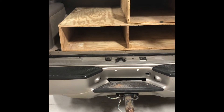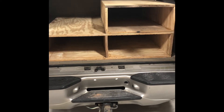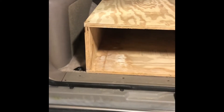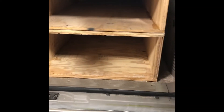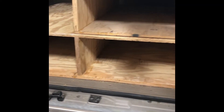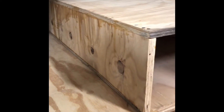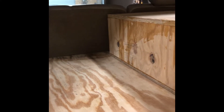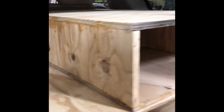I'm not going to get into how to build drawers — this isn't a carpentry video — but basically we used some three-quarter inch plywood we already had and will make three drawers next. All this is glued and screwed together. These are 46 inches deep. The second one up here is independent, not bolted down yet — I think that one was 41. You have to account for the slope of the back seat as it leans back, so the higher you go the shorter your measurement will be. We're 46 on one side and about 43 over here, which is fine — this is all storage.